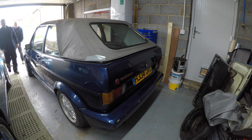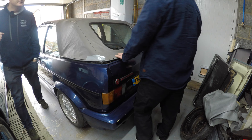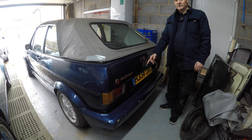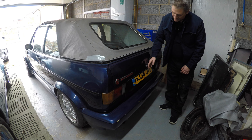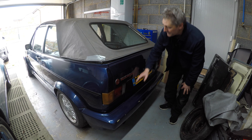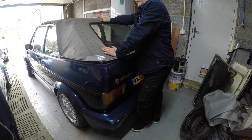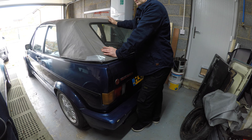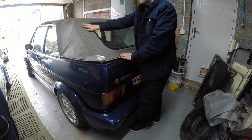So your mark one golf cabriolet - they suffer from various rust issues, including the missing tailgate seal. Unfortunately what happens is these perish and fall out; many people don't realize they should even be there. What happens is water will come in, ingress through the gap, sit into the bottom of the tailgate and it will rot away. Secondly, normally from factory the hoods were made from PVC vinyl - people call them different things - but these suffer over the years from UVA sunlight attack which breaks down the plasticizers of the material itself. The material really is a cotton sheet with molten plastic poured over the top, so during the manufacturing process it's put under imprint rollers which give it the texture.